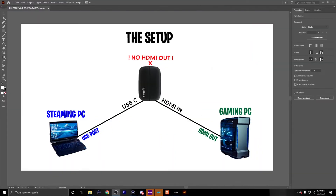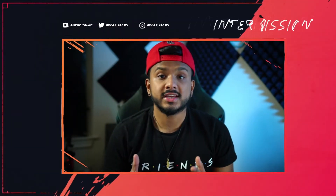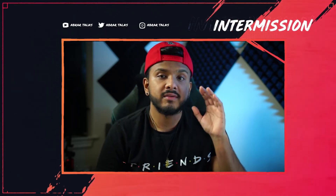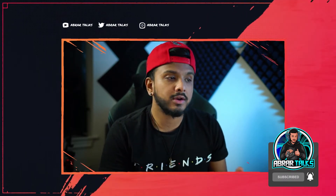Let's go over the wiring setup. I've put together a quick diagram — to the right is the gaming PC and to the left is the streaming PC. I'm using a laptop as my streaming PC and my custom-built PC as the gaming PC. Take an HDMI cable and plug it into the HDMI out port of your gaming PC, then route that cable into the HDMI in port of the Elgato HD60S. Then take the USB Type-C cable that came with the Elgato and plug the other end into the streaming PC. That's it — you don't need any other wires. The HDMI out port of the Elgato HD60 is not needed for this setup. You'll also want at least two monitors, though if you're using a laptop you can use its screen.